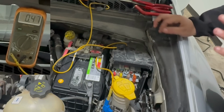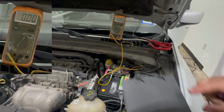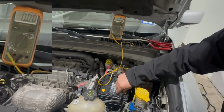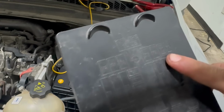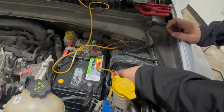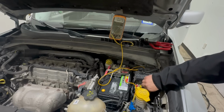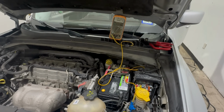Okay, that went down. All right, this is a 4, fuse 4. Okay, hey, she turned off. Look, check that out. No more draw. Okay, so this is fuse number 4, and then fuse number F2. Let me see if I put this on, what happens. All right, there's our draw again. Remove this. Come on, baby. Shut down. There you go.